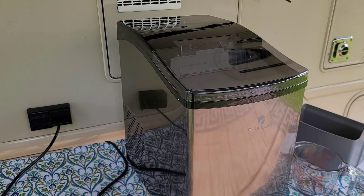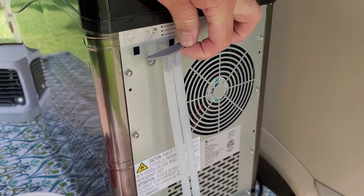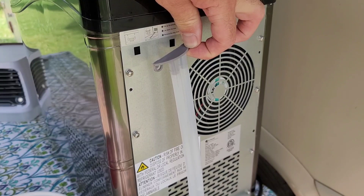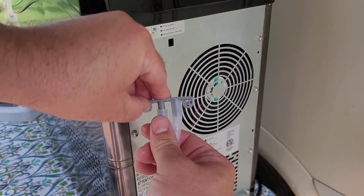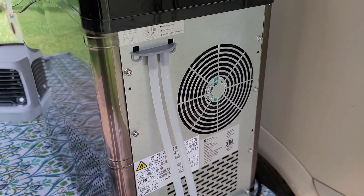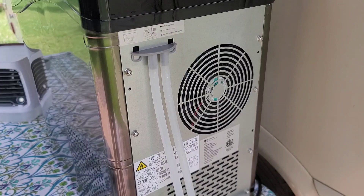The directions reference a citric-based formula, but the vinegar-water mix works just as well. After the cleaning cycle is done, you lift up on the drain tubes, unplug the plastic piece, and let that cleaning liquid drain out — it does not run through the machine to make ice. Then hook the tubes back up, clip it back in, and I'm going to run the cleaning cycle with fresh water about three or four times. In hindsight, I may look into that citrus-based cleaner because the vinegar water took a long time to rinse out again and again before I no longer tasted the vinegar.